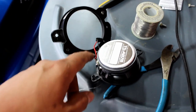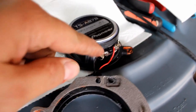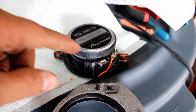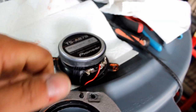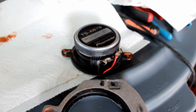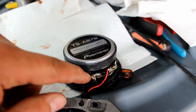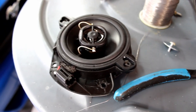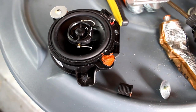It's probably a sixteenth of an inch or less difference. I had a clearance issue with the posts that came vertical — it would be fine, plugged in and playing, but as soon as I torqued down the last screw it would touch the door, short it out, and shut that channel off. So I cut the little tabs and soldered directly to the bottom pads so I won't have any problems.